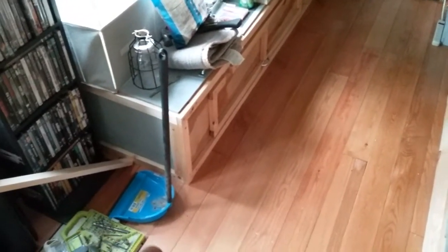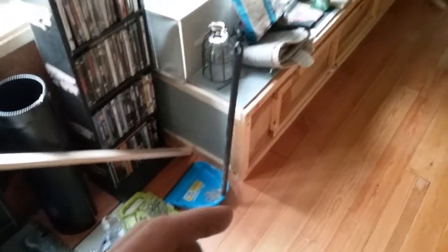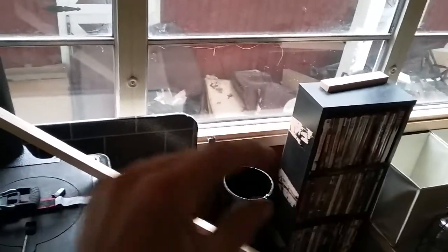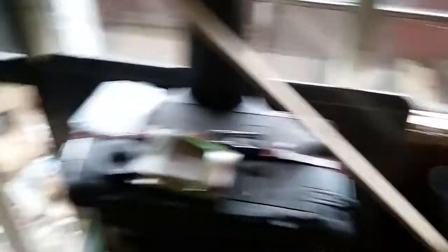I also did the heat shield underneath the bus. The heat shield underneath the bus is for the plastic water tank that sits above the exhaust pipe. The exhaust doesn't get really hot towards the back — it just gets warm — but I don't want anything happening where I'm driving across country and it starts getting hot and warping the bottom of my tank. So I used the back of one of the big seats and cut a nice piece of sheet metal out, spray painted it the same color as the bus — gloss almond — and put it underneath the entire length of the tank where the exhaust runs.